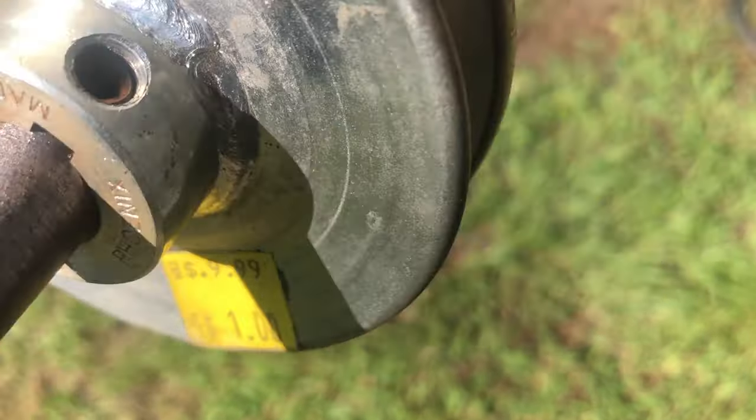So I just did a fine tuning on the clutch swing arm. It does not hit the pulleys. It's right in line with the pulleys. And if we look downstairs, I've got the front clutch cable bracket in place. Now we'll get the clutch in there, put a bolt in here, get it all hooked together and test it.